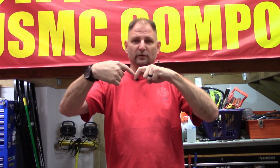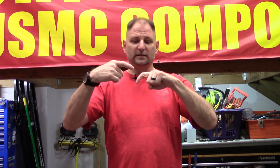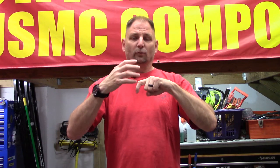You can do it. You need a soldering iron and a lot of patience, and you need to be willing to just make sure, like I said, I practiced multiple times before I ever plugged that soldering iron in. That pin 60 looks kind of like this as it connects to the circuit board and that connector, and I literally took that soldering iron cold and just did this until I got to a point where it's like, okay, I'm not going to hit the board. I can absolutely touch that pin. And it's just a matter of putting a little bit of solder on that tip, hitting that pin, watching that solder melt and coat that pin again, and redoing that solder joint. And that's the fix. And it works, and it's a solid fix, and it's good.